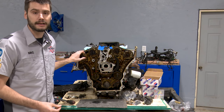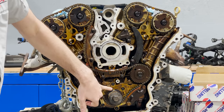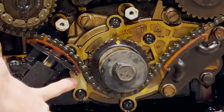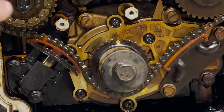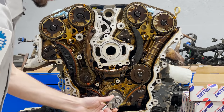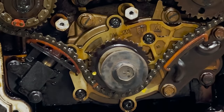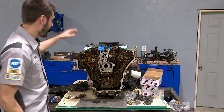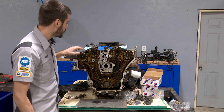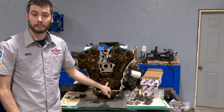We're going to start with the engine in stage two timing. We'll spin the crankshaft over clockwise until we line up our crankshaft mark — I've marked these yellow so they're easier to see — with the mark on the oil pump, which is at about the eight o'clock position. You'll know you're in stage two timing when the flats of the backsides of the camshafts are facing upwards. Right now we are actually one full crank revolution out, 180 degrees off on our cams, so we have to bring the crank around one more time.